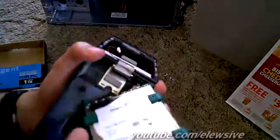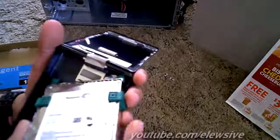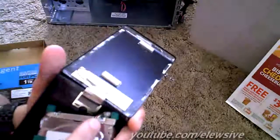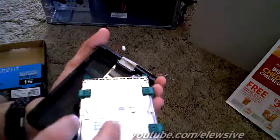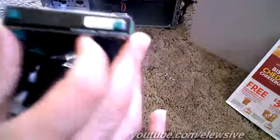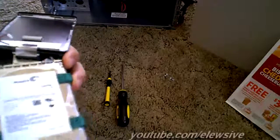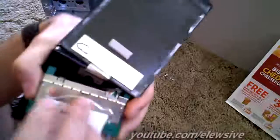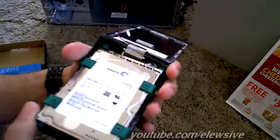You've got one, two, three, and four — so once you take out these four screws total, this drive should be ready to go. Back here there's a little connector that gives it power, so you have to yank that out. Once you have that out, you should be good. Note that you don't have to remove the grommets — this little metal shell is only shaped like this, not covering the whole drive, so once you get the screws out it pops straight forward. I recommend pulling it this way because of the connector in the back — you don't want to pull up and damage anything.